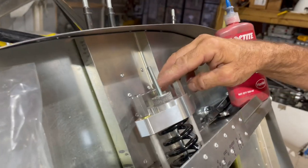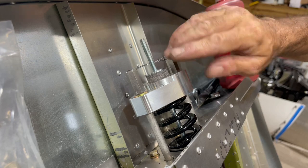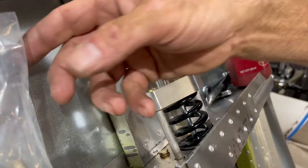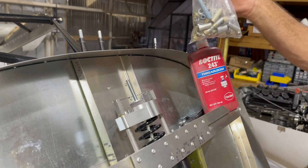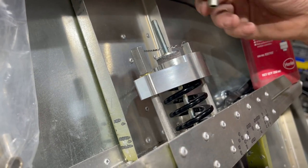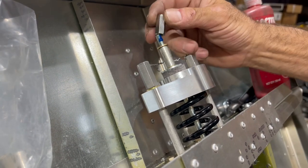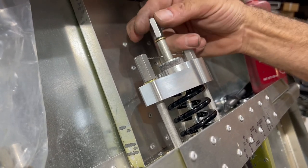I've got this safety wire done and these screwed down — almost so you can't get the wire through. I put a little bow in the wire so it doesn't interfere with the middle, because the middle does move up and down. I have a lot of thread here and I don't want to use it all — I want to be able to use it to actually adjust stuff. I have a bag of these little spacers — great thing to pick up at an air show in the flymarts. I'm going to put a washer, then a spacer, then another washer for the nut to bear on, with a little blue Loctite so it doesn't spin on its own. This becomes our adjustment for how heavy or light we want the rudder pedals to be when we sit in the airplane.